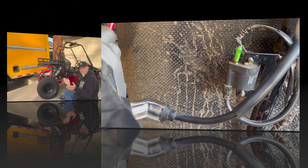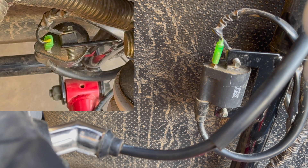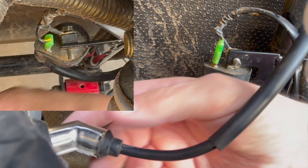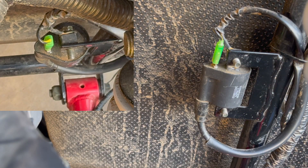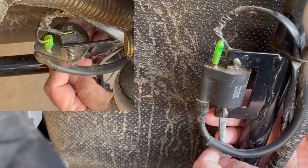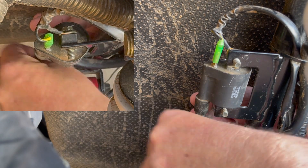Okay, so let's get on with this. What you've got here are your two 8mm bolts that are bolted up from the inside on the back. Then you've got your plug wire. You're going to want to pull that out. You'll want to get an 8mm ratcheting wrench — or a ratchet, whichever you prefer — get under there, loosen it, and pull it on out.